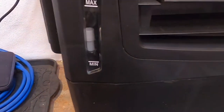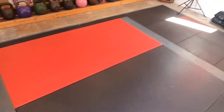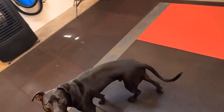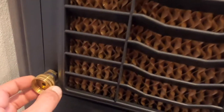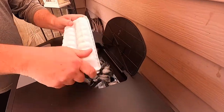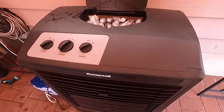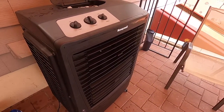There is also the cool feature. When it's off, basically just the fan is operating. But when you turn it on, there are honeycombs on the sides and the back that Honeywell calls honeycomb cooling media. The water gets pumped up and trickled into these honeycombs, which get saturated, and then the fan gives you much cooler air that's almost hard to explain — you kind of have to feel it. It doesn't feel like a fan blowing hot air at you, and it doesn't feel like an air conditioning unit with a compressor feeding cold air into your face. It's much more enjoyable and comfortable.